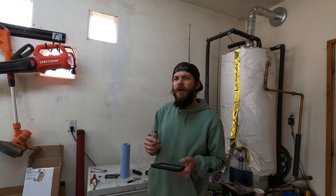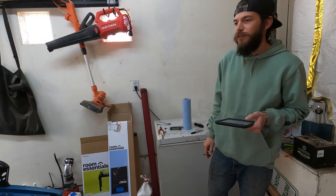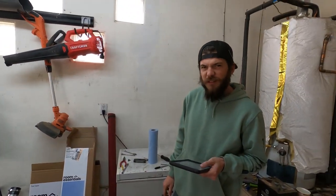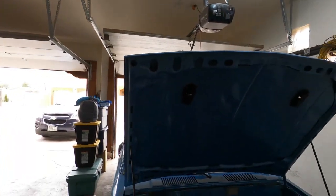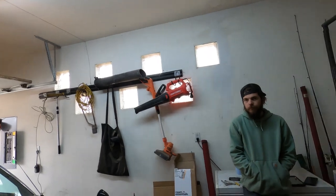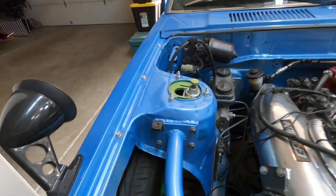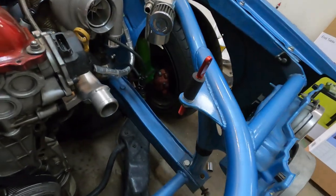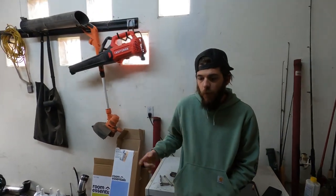Rob arrived to help — I need help taking off the hood and maybe pulling the motor. He's actually the producer of the music on these videos, it'll be in the description. Now that everything's off and the hood's off, you can actually see the motor. Time to take off the front clip — it's got four bolts on each side, Allen bolts, 10mm on each side, and I think 17s and Allens on the bottom, and then the whole front radiator support comes out.